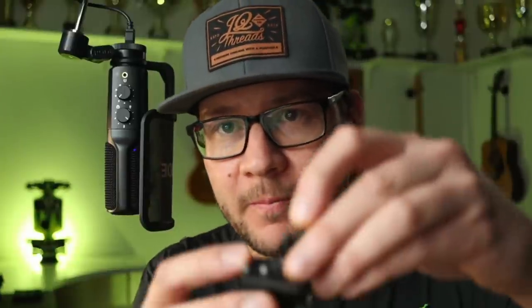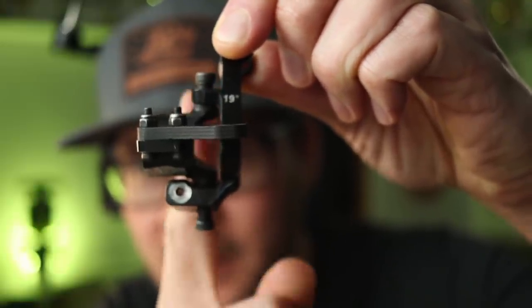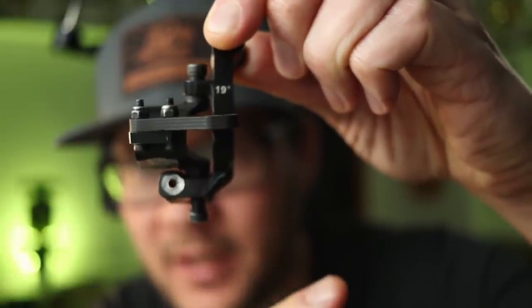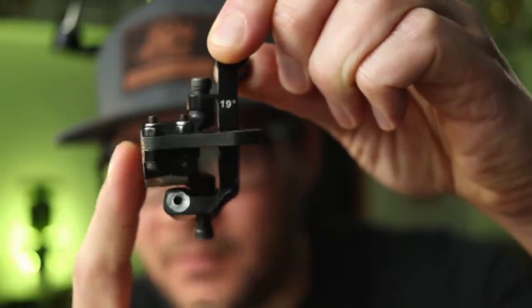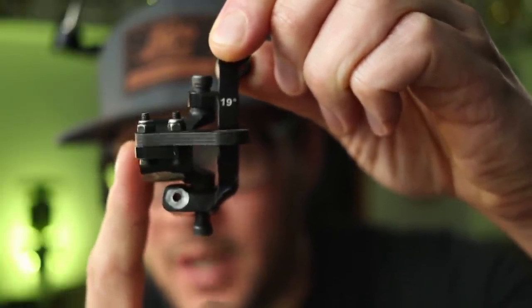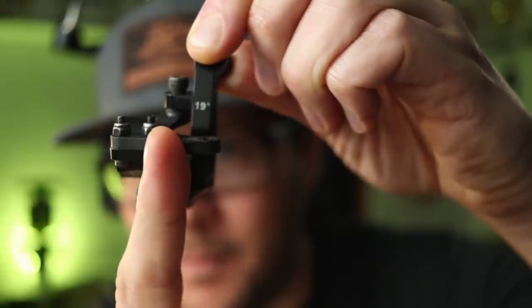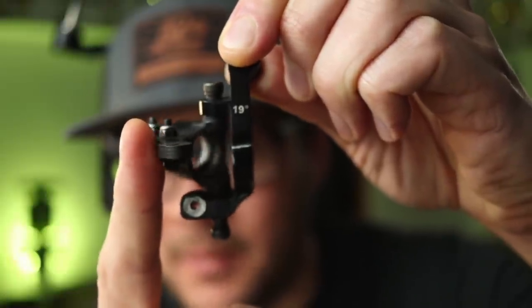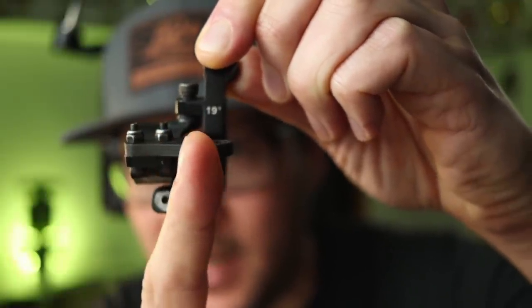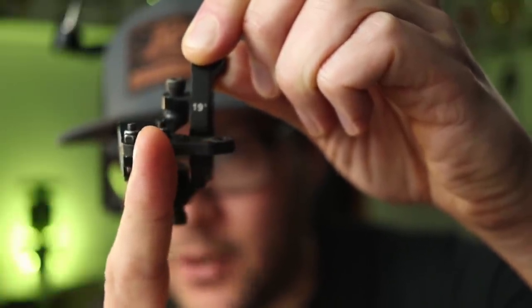I want this to be 100% clear to everyone. Here you can see that at zero camber, the kingpin axis - steering axis - is also at zero, so it's vertical. Any sort of force to the outside of that turns the knuckle. If I go perfectly in line with the kingpin and push, nothing happens - I can't turn the knuckle. If I go outwards, it turns immediately. That's because I created a moment arm between the steering axis and the location of the force.